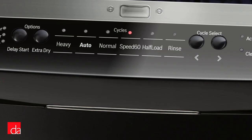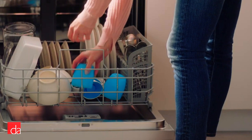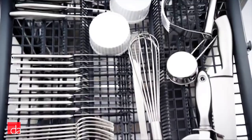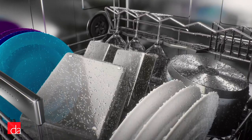The 100 series has all the basic wash cycles you'd expect from a modern dishwasher: auto wash, normal, quick wash, power scrub plus for heavily soiled dishes, economy wash for delicate items, and half load. You'll have the option of going with a traditional silverware basket, or you can upgrade to Bosch's cutlery tray for added loading flexibility. As for drying, the 100 series features Bosch's basic PureDry condensation drying, which heats up to 160 degrees, creating ultra-heated surfaces allowing water to evaporate from most dishes.